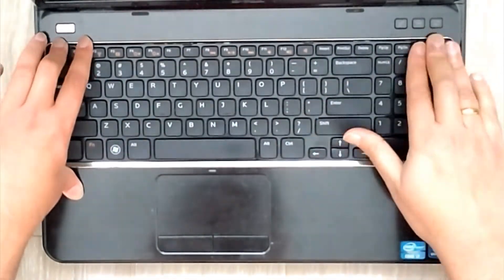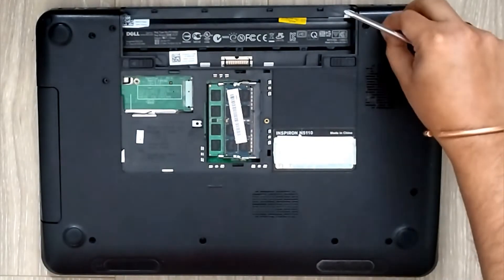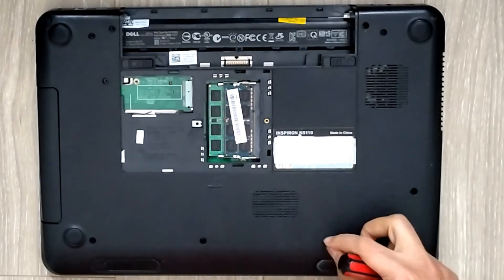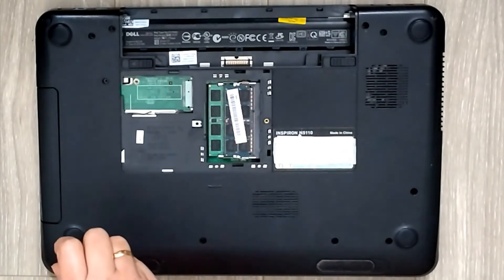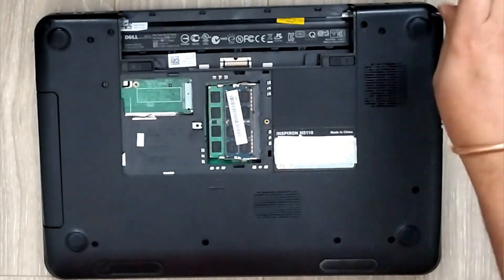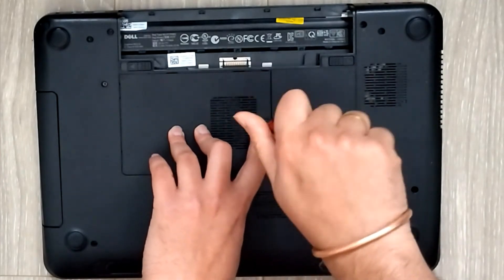Put the keyboard bus and snap the keyboard back into place. If you have the screws for the disk drive, also put it in with the safety screws near the RAM that you can see in the center of the screen - otherwise that's fine. Put the other screws back in, and the battery, and then put the back panel on using the bottom-left approach: snap it to the bottom first and to the left, then push it in and it should go inside.